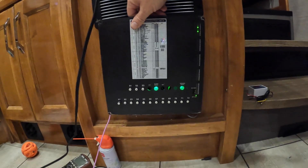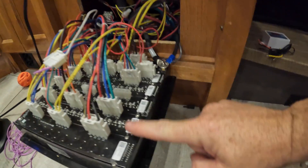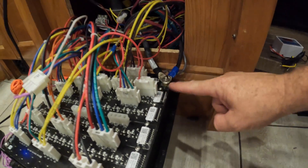The problem we were having was with our tank heater — that was the very first thing not quite working. We'd get some chatter and found out it was a bad board. But it's more than just the board. Everything is controlled right here, what they call the spider control. Unfortunately this unit is twenty-eight hundred dollars, and it's a three to four week lead time because they have to program it.